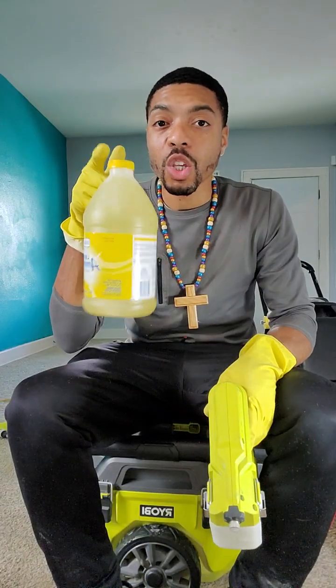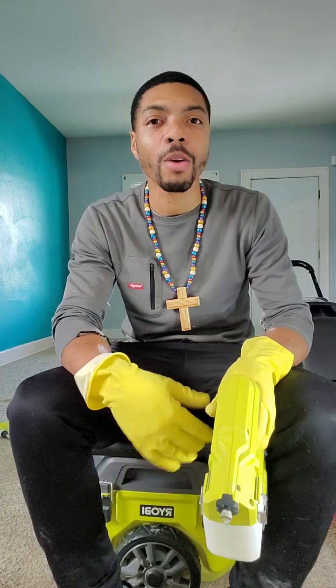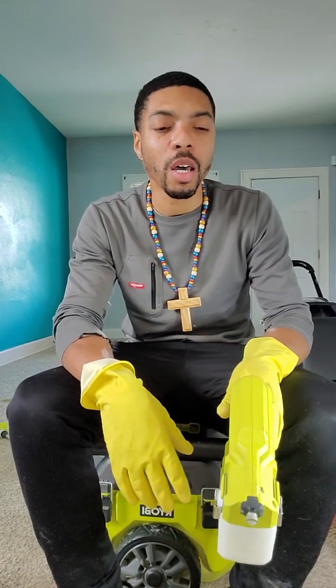I remember when I had a van to clean out, and I was cleaning the seats in the van, wintertime. I didn't want to pull out my carpet extractor because I didn't want the pump to freeze. Look, there were layers of sticky dirt on that seat. You want to know how I cleaned that seat to an almost brand new state? I used half and half ammonia, sprayed it, scrubbed it, and rubbed it all off with a cotton rag. They came out and said, man, you shampooed the mess out of these seats. I had the extractor sitting right next to me. I thought about using it, but I didn't want to flush it out from the antifreeze and all that. It was wintertime, and they said, man, you really shampooed the mess out of these seats. I'm like, I did, didn't I?